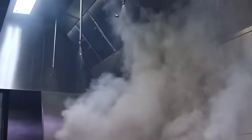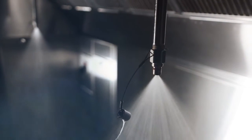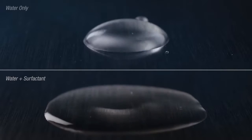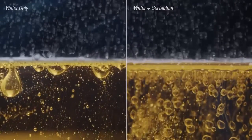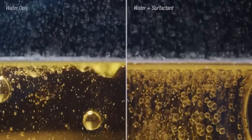In the case of CORE, we do add water to a grease fire, but we do it in a very particular way. First of all, we add surfactant to that water, which is basically just a soap, and it reduces the surface tension between the water and the oil. It helps flatten the water out on the surface of the oil and helps the water mix within the oil more effectively, which helps take heat out of the oil and ultimately helps cool the appliance and prevent re-ignition.